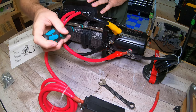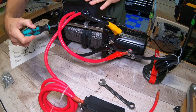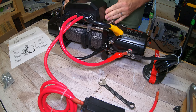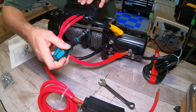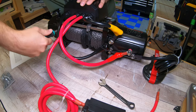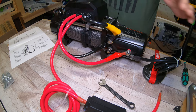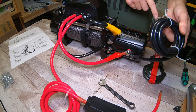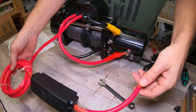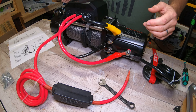To tighten down the solenoid box, just unscrew the screws — they come with a little loctite pre-installed — and it snaps into place. Center it and give it a good tighten. That's all it takes to wire up this winch. When you're done, your negative lead goes direct to battery and your positive lead with the pre-installed circuit breaker goes directly to battery. Everything else is ready to go.